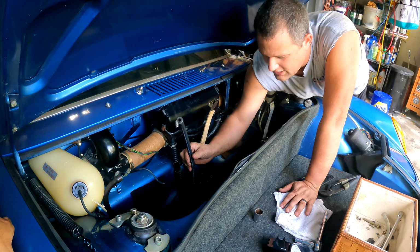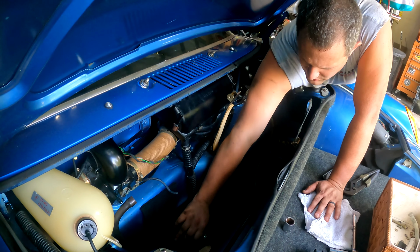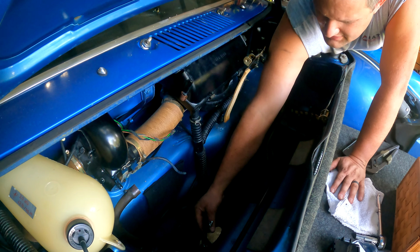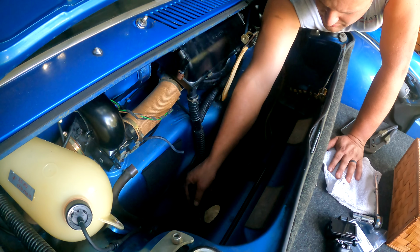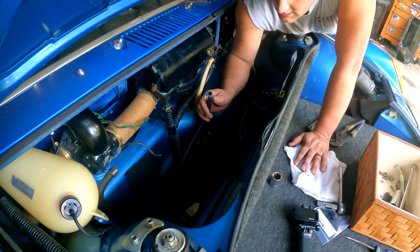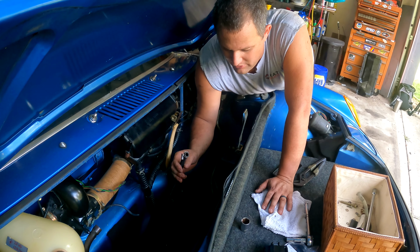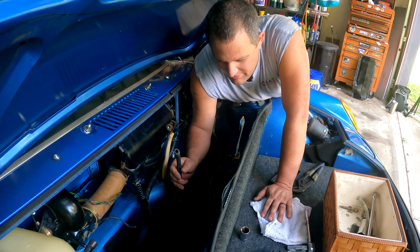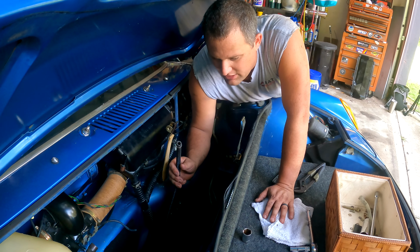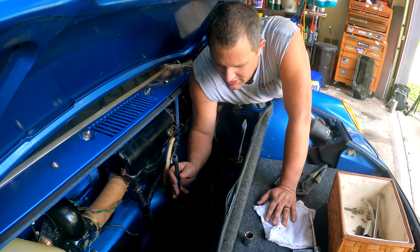And make sure that you've got your hose. So when this hose goes in and down, you really want to get kind of a twist in it so it lays down nice and flat and it doesn't pinch. It's going to have to lay down pretty far into here. So routing that can take a couple of tries, but it is something that you need to make sure you do. About 22 inches seems to be about the going rate for this line coming out of the tank. So we're going to go ahead and bring it over. It is dry now, so we can go ahead and hook up the tank to this and then see about getting it put in.